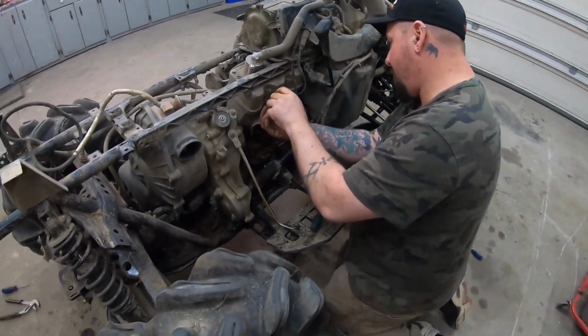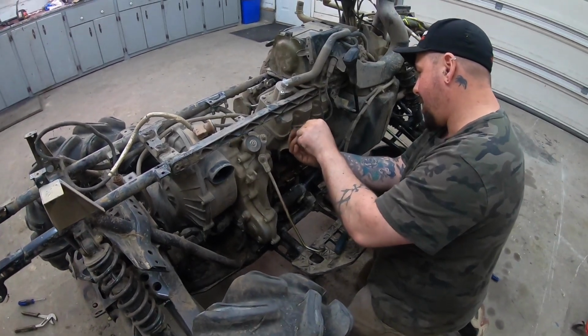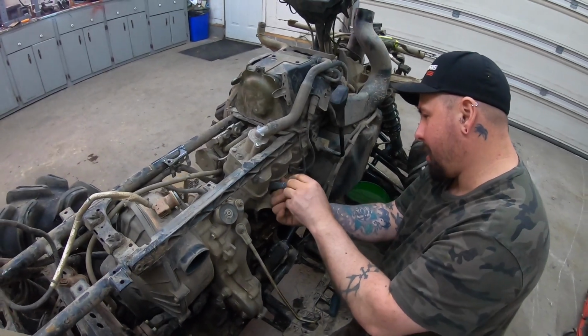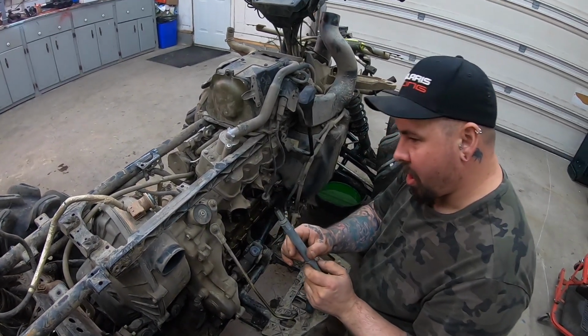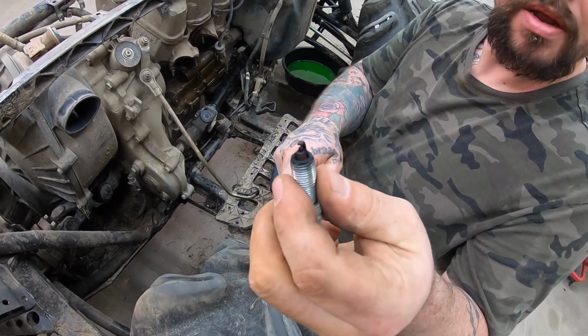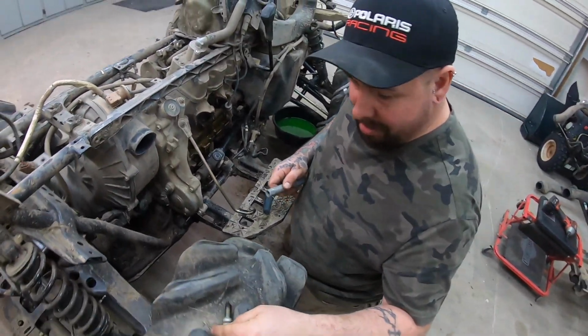So we're taking spark plugs out of this. We know one's not liking life. There's a few things that are... Man, these are Champions, and I don't care what anyone says, Champions are junk. Yeah, they're burnt red. Mind you, they did do good.